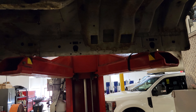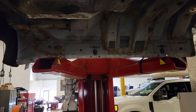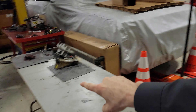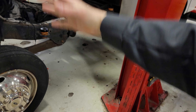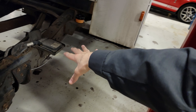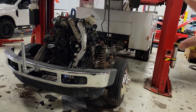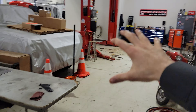Single cabs are a little trickier to lift just because of where the arm placements are going — kind of a pain in the butt but I can get the job done. I do have to take out these arms; they slide out of this and it makes the arms shorter so I can get underneath where I need to be. I have to worry about the hoist arms hitting the frame ears or the TCM. Pretty much my go-to hoist for removing cabs.